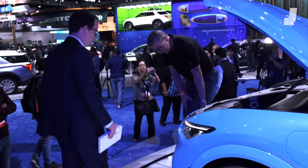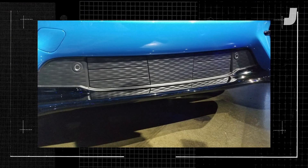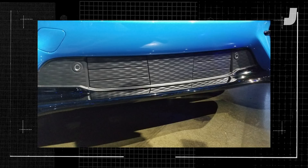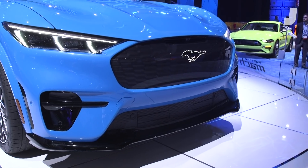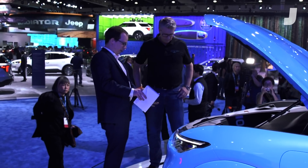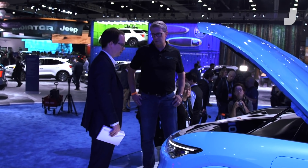The other thing we have is what we would call Class A grill shutters. They're closed and they'll be closed probably 95% of the time. Actually, one of the biggest times when they open is when you're charging the battery — batteries get warm, so we open that up for breathing. Right now there's no grill opening at all. On one of those, you've got a radiator and on the other a condenser — yeah, we've got your normal radiator-condenser setup.